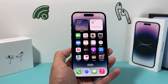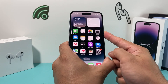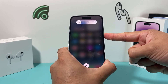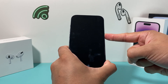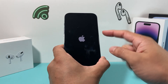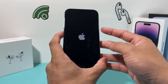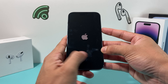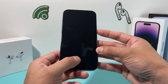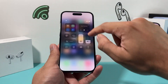After that, the next thing you want to do is force restart your iPhone. To do a force restart on iPhone 8 and above, press volume up, then volume down — press and release each — and then hold the side button until the screen goes completely black. Wait until the Apple logo reappears, then let go. On an iPhone 7 or 7 Plus, hold the volume down button and the side button together until the screen goes black. On an iPhone 6S or older, hold the home button and the power button until the screen goes black. Once you're back on, hopefully the control center is now working.